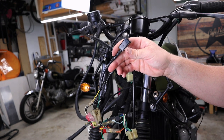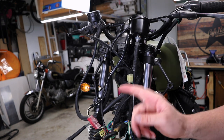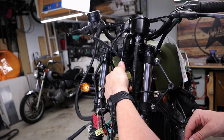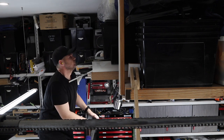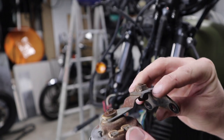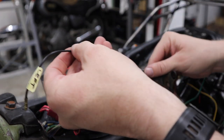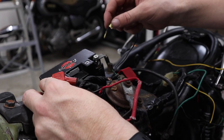So all I've got left is the horn, which I think I've got to hunt around for somewhere. The original one — I think that's the voltage regulator actually. I don't have a temperature sensor in this gauge, so if anyone has any ideas on a cheap temperature sensor so I can keep an eye on it in case it gets to a certain temp, please let me know. Up there there's a box labeled 'CX stock parts' — I'm going to go and climb up there and see if I can find that horn. We have a horn! So that's pretty much the stock horn — it's not pretty, but it's got a bracket. I plugged it in to see if it works but nothing. Process of elimination — I've got a couple of wires attached to the back to check the horn first. If that works then we know it's the wiring; if it doesn't then we know the horn doesn't work. And nothing — okay, the horn is not working.